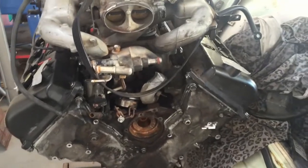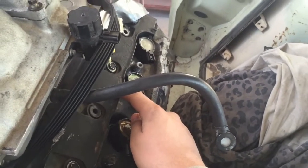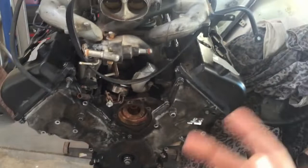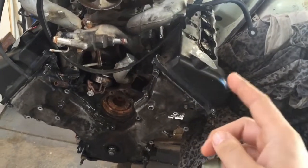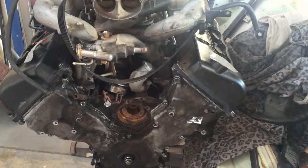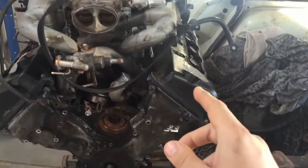This is the Navigator engine from the junkyard. Both exhaust valves were leaking — this one the seat on the exhaust valve was completely shot with a burnt valve, and this one just had a burnt valve. So it wasn't holding compression; there's no way I'm going to run it like that. It needed a new cylinder head, or serviced — it would have been cheaper to buy a cylinder head for like $100–$120, I could get a used one off eBay, or $150 from the junkyard.